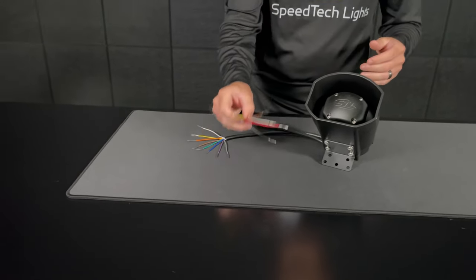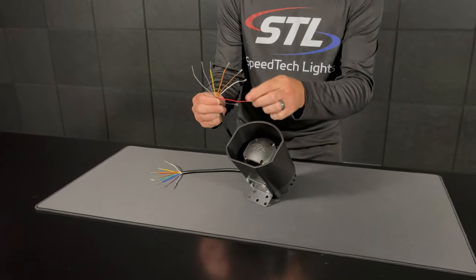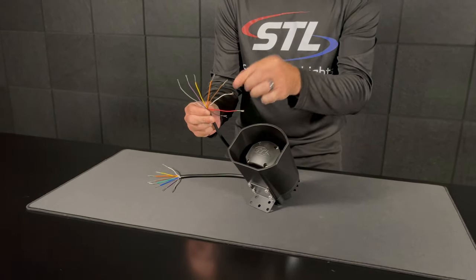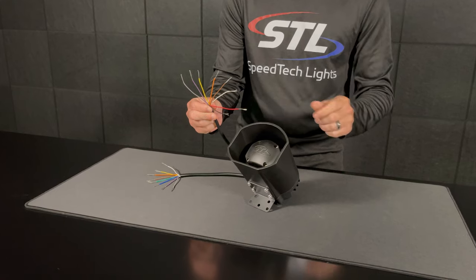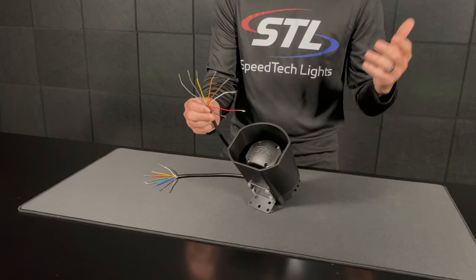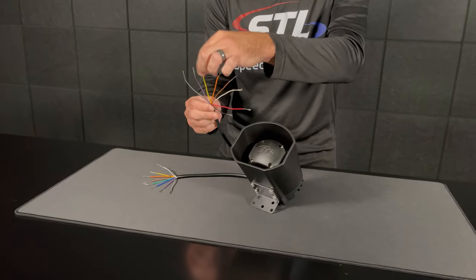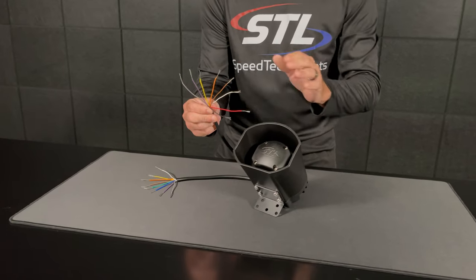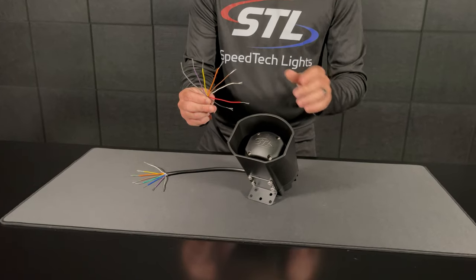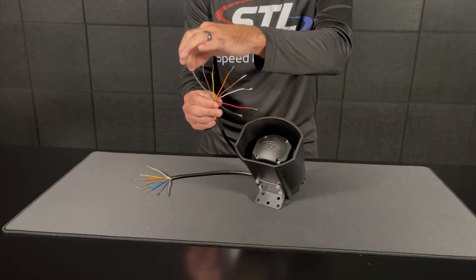One of your cable harnesses will be your power and functions cable harness. You'll have your red positive, your black ground, and your white sync cable to sync up to two Fury Moto Sirens. Then you'll have your brown and orange cables to hook up an external speaker such as our cone or icon speakers. Your yellow and purple cables are used to run your Fury as a speaker only. If you'd like to use the radio rebroadcast feature, you'll only use the purple cable. And then you have your gray park kill mode cable.